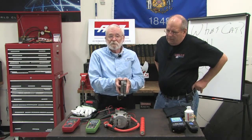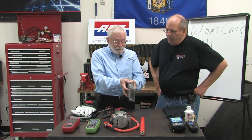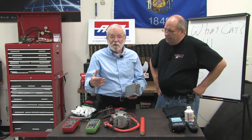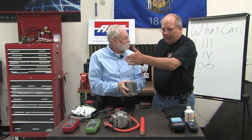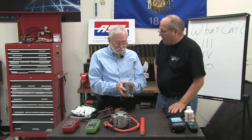And that's what your battery ECU is monitoring. So if it sees one of these blocks has got some problems, and maybe some low voltage, or it can't charge properly because of a bad connection, your scan tool could read that. It'd be a block voltage. So it'll point you to that block. Okay, so then it narrows it down to one of these two as a problem, or both.